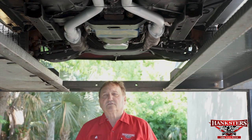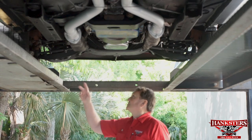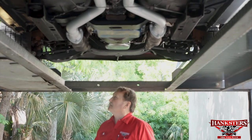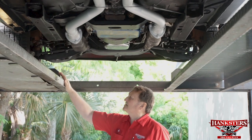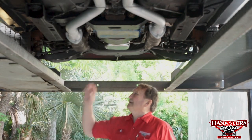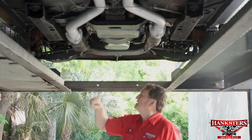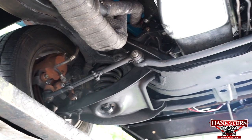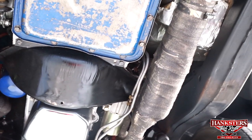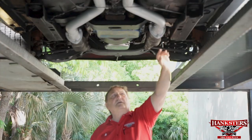We're underneath our 1968 teal-colored SS-style Camaro — really fantastic car. New shocks in the front. Aluminum radiator. Front disc brakes — the rotors are really, really nice and clean with no marks whatsoever. Calipers are nice and fresh with all new hardware, and all the lines are fresh and new. Wrapped set of long tube headers — I'll call them inch and three-quarter. New tie rod ends. Steering box looks to be original but doesn't need replacement. Gear reduction starter. There's heat shielding close to the header as well.